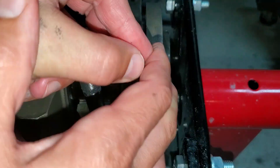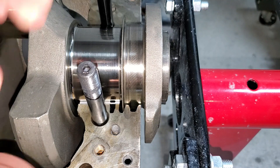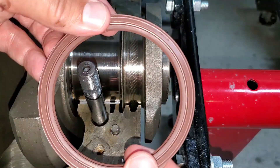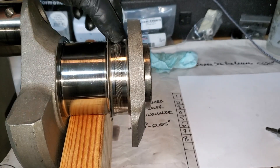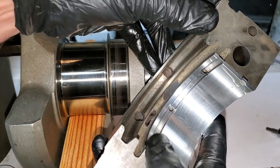If you can, take the crank out. But go ahead and try it if you want, and contact BOP if you want more instructions on the crank-in method. I'm going to take this out and show you how to put the seal on at the workbench. Here's where it goes — you can see this little hash mark helix pattern on the journal of the crank, and then our mating part.